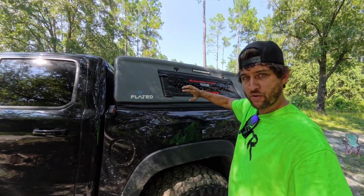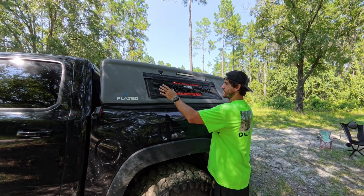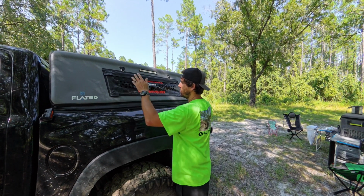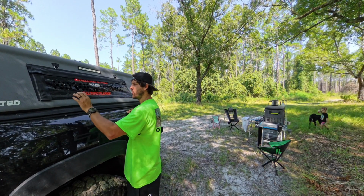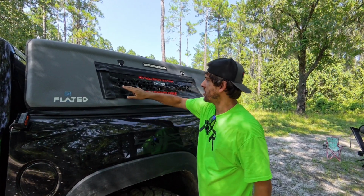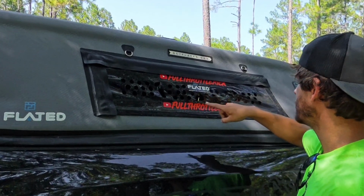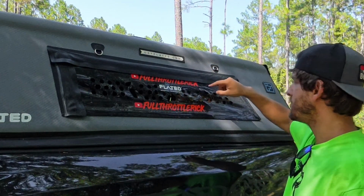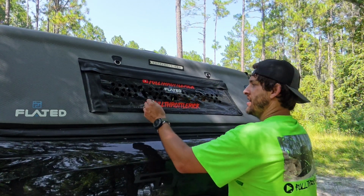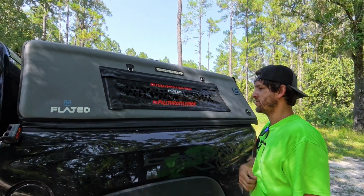But if you want to make a ventilated window, I think they're like $60 for the pair of solid windows. Get yourself another set of solid windows and take a hole saw, or I wouldn't use a drill, I'd use a really, really sharp brand new hole saw, and do it when it's cold out, not when this window is heated. Because if you look, we had no problem with relatively even holes, and then we had these ones that got away from us, and we just kind of made them into our own design because the window was getting warm and hot and soft during the day in the sun. And so when we put the hole saw in, it would just go boom and almost take out. I'm super happy it didn't hit the actual topper, because then we'd be toast.